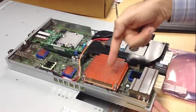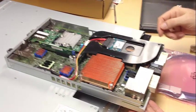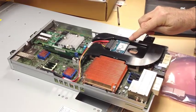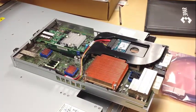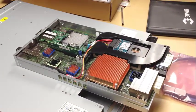This is the ASIC with the giant copper heat sink. The ASIC is underneath there. The SSD is right there on top. It's a 64GB SSD that holds the operating system and it also holds the de-staged contents of cache on a dirty shutdown.